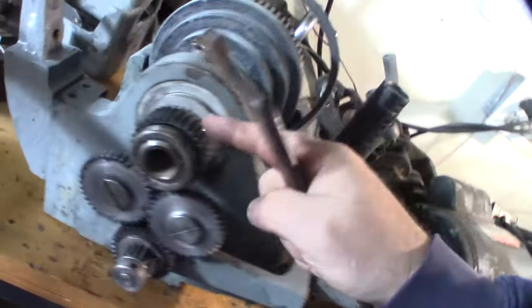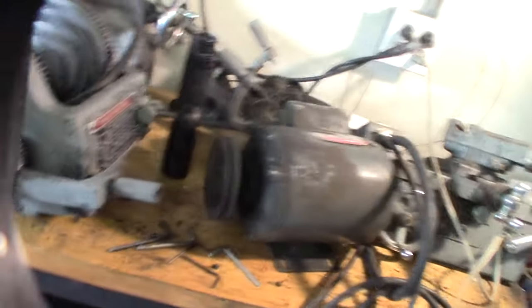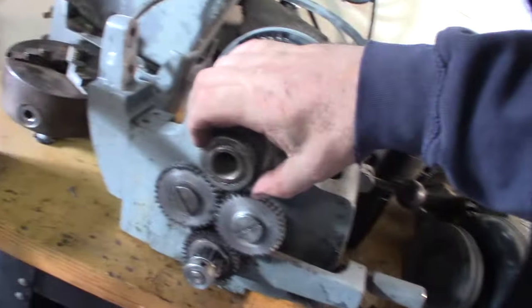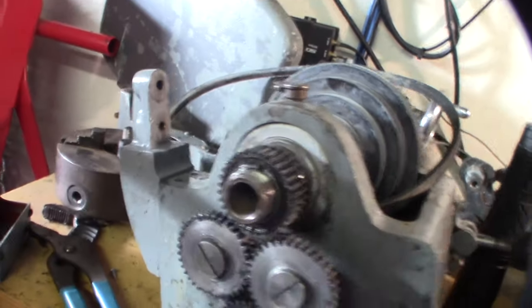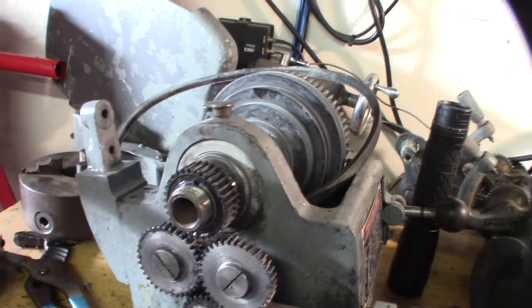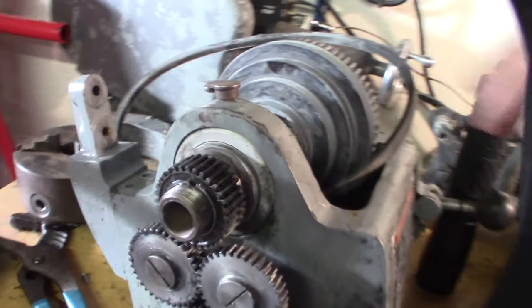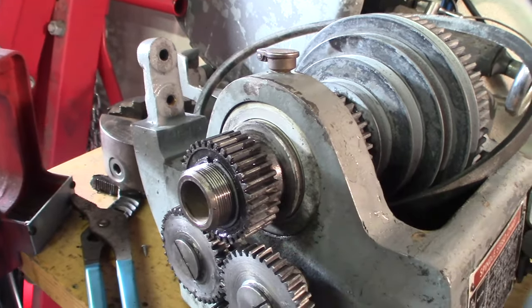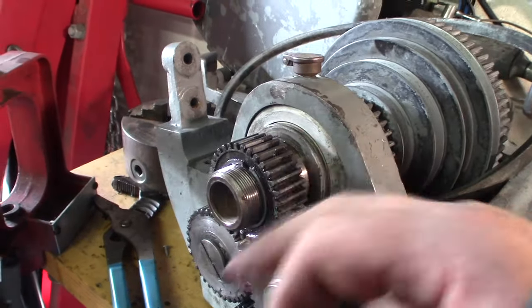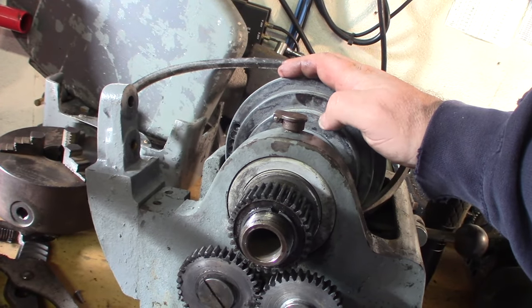The hole was too big so I carefully used my vice grips. It's actually counterclockwise, so it is not reversed. There does look like there is a key there. Because this material is so fragile, I wouldn't use any sort of steel tool - I'm carefully soaking everything in WD-40 penetrant oil, and I might get some wood or plastic to wedge it out. You can see how soft this stuff is - it feels like the same material they make old school carburetors out of, like a magnesium alloy.